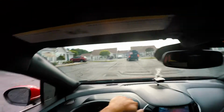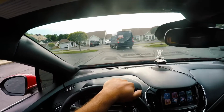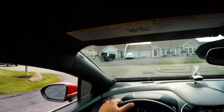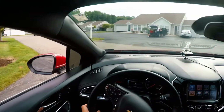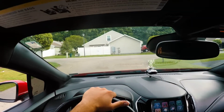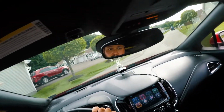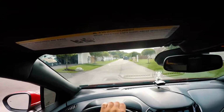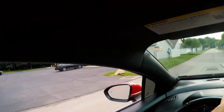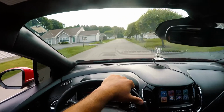All right, hoping we don't see check engine light. I hope it just drives better. Like I said, I didn't really want to do the intake. Last time I put it on the first gen Cruze I got, I really didn't see much, it just gave my diverter valve a little whoosh, but not a lot. This diverter is definitely louder. And I've heard, with a tune and stuff, it's even louder. I'm gonna see if the car will relearn everything with the MAF sensor and all that stuff, and then go from there.